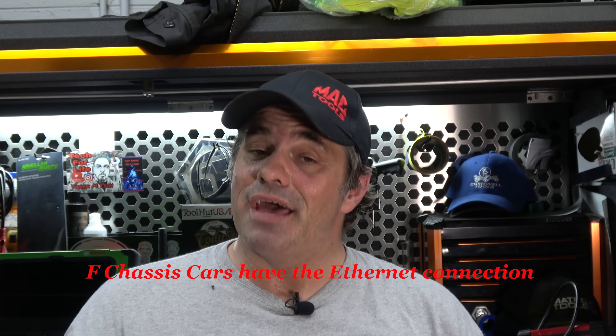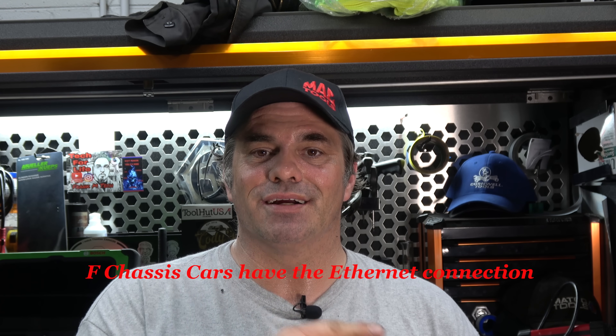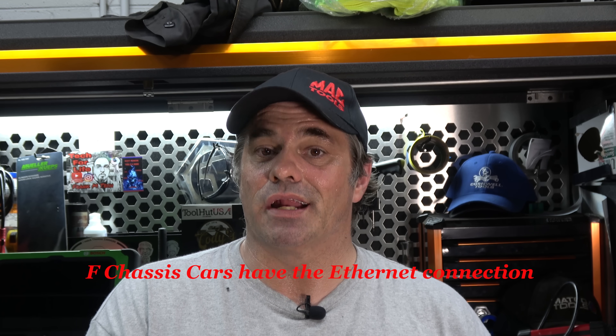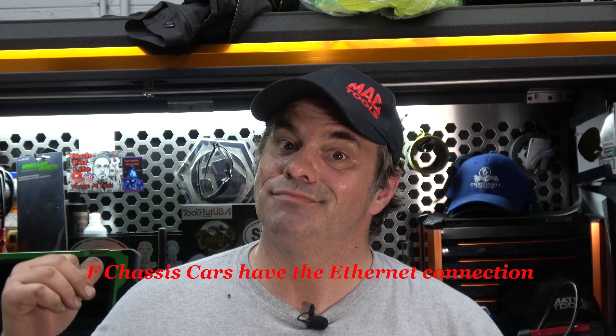It's important when you're pricing out a reflash event that you do some research, because you may not be able to do it with a J-Box — simple as that. BMW on their F cars can be a programming nightmare. You're pretty much limited to aftermarket tools that allow programming, like Autologic, because they'll only program one module whereas BMW wants you to program everything. They do it through an ethernet connection to the car instead of just through the DLC. So if you're into BMWs and going to be programming a lot, you might want to look at an ISTA — it's actually cheaper than a Cardaq.